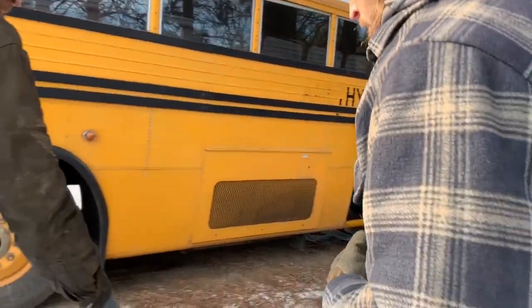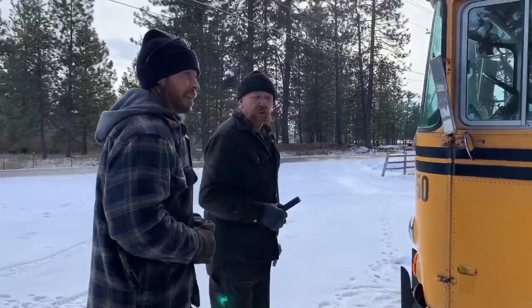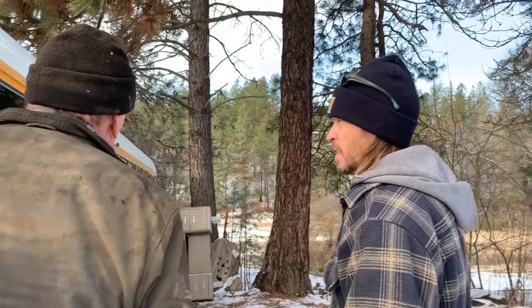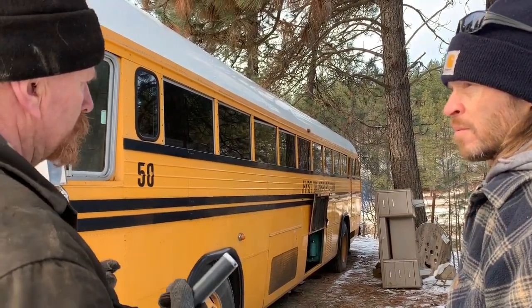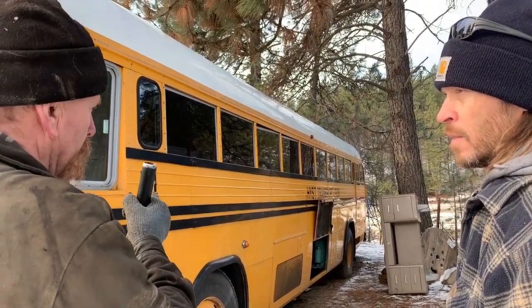Oh, okay. So when you first started it, did it really seem that the fuel was better? No, and that's another thing. Don't ever run it out of fuel. This thing was hard to get started, because any diesel, when you run it out of fuel, empties the system, so you have to bleed the system. These are probably one of the easiest. If you have a good starter and good batteries, it can pick up its own prime.